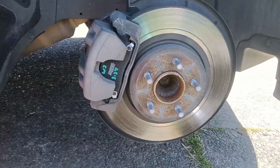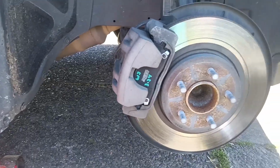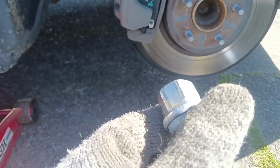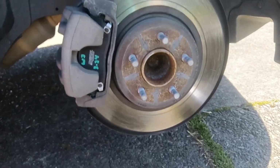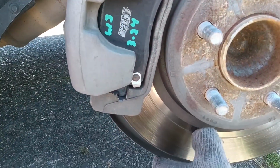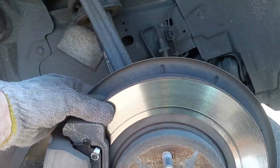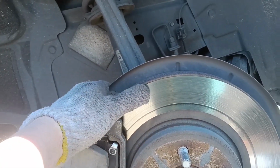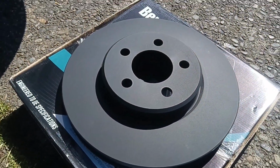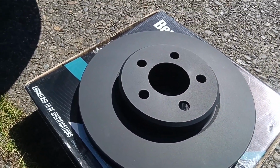All right, well, sometimes that's how it goes. Rinse, repeat. We still got some stubborn lug nuts, although they ain't nearly as stubborn as they were now that they've been worked multiple times for me. Using 7/8 today. Don't laugh. That's what fits best. Old rotor. This one's glassy and classy. We got a deep dug groove. And I believe we had super bad pad on the inside, so that probably looks rough. So this one is ready to go. Here's our new Bendix Fleet Metlock right here, looking beautiful, ready to install.